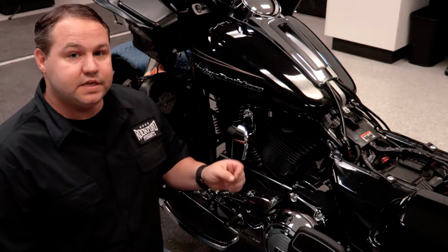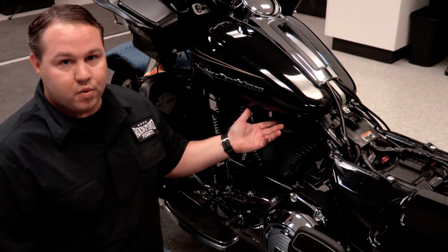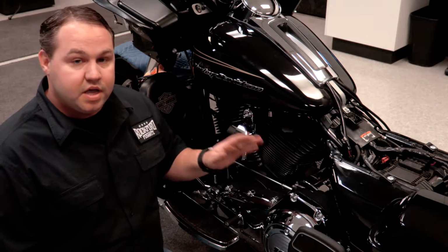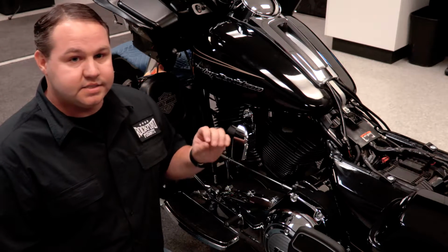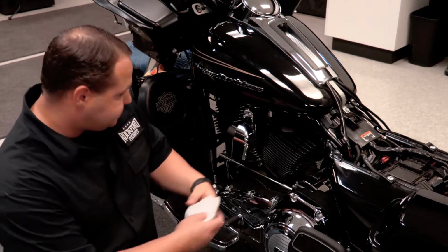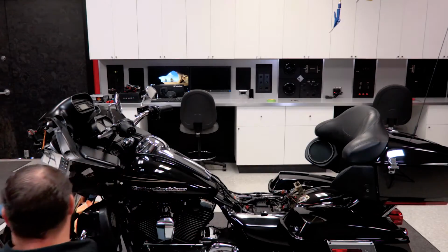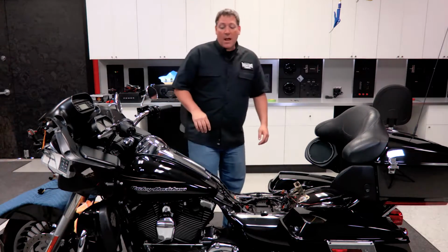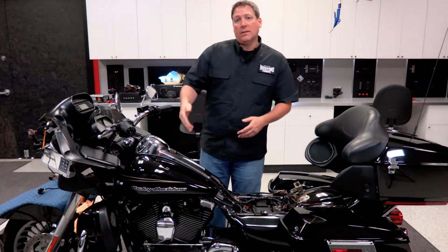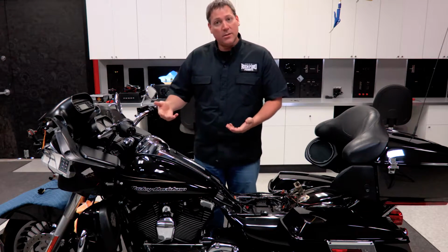With the bolts removed and electrical connections undone, we can now move on to our fuel line. Ours is on a quick release, so it's very easy to do. If you have an older bike with the other style and you're unsure on how to take it apart, see your owner's manual for advice. Alright, so now that we have all the bolts out and the tank disconnected, we can go ahead, lift the tank off, set it aside, continue the installation.